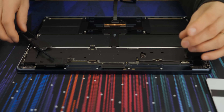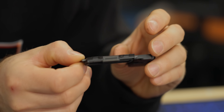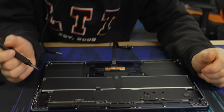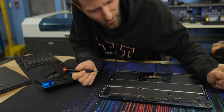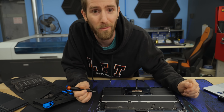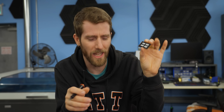A whole bunch of stuff is coming out. These are Apple's wild force-canceling speakers — each one apparently has three speakers in it and they sound really good. They are not going back in. Our next step is to remove the ribbon cable from the MagSafe connector and then shimmy out the MagSafe. How are we going to charge the thing? With USB — we have no MagSafe anymore. We are going to lose some functionality here.